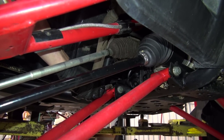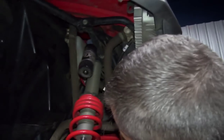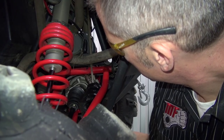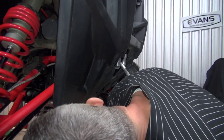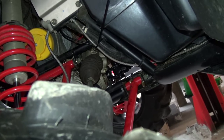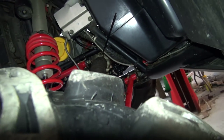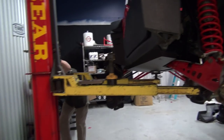Got your A-arm fittings here — you just wanna see a little bit of grease come out. You don't really have to nail it hard. There's only one on the top. You'll see it start to squish out, and there's one on the very bottom. I've got another zerk fitting there, but I'm gonna have to put a new nipple on that. Right now I'm gonna lower this and we're gonna hit the shafts on the inside here — some people might call them intermediate shafts.